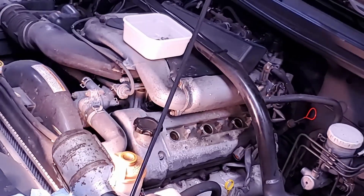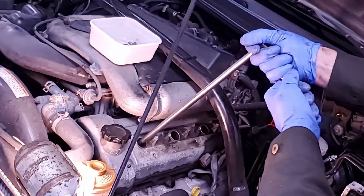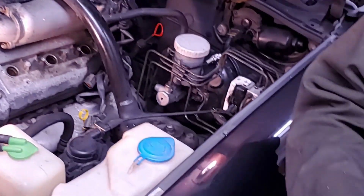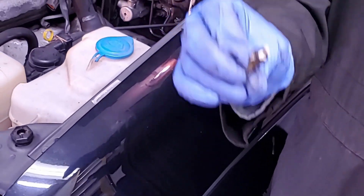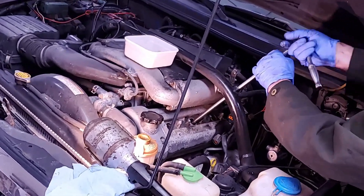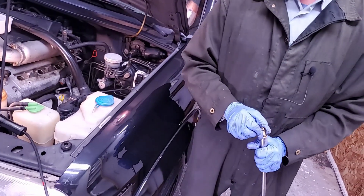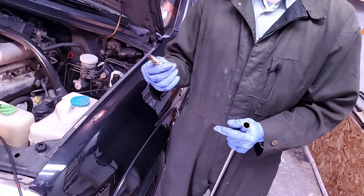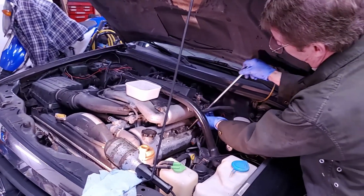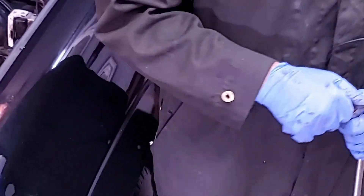Take your plug wrench — it's not too bad, a little build-up but not much. There's a short extension on this one when I put it back together. Yeah, they were due to be changed. A little bit of oil — some of the valve cover is leaking a bit, but not too bad, nothing I'm going to worry about. Same thing — not burning oil, just a little bit of build-up, but like I say they've been in there 100,000 kilometers.